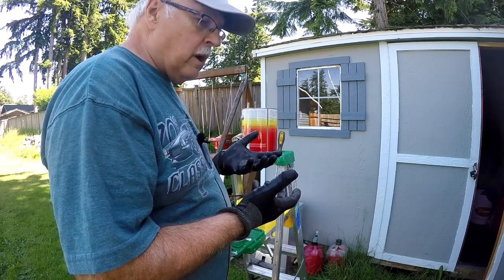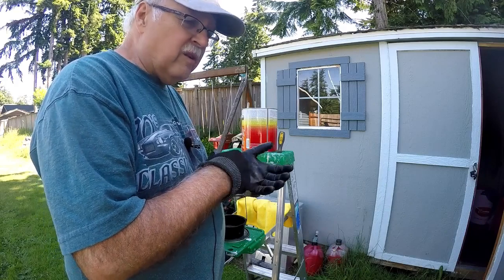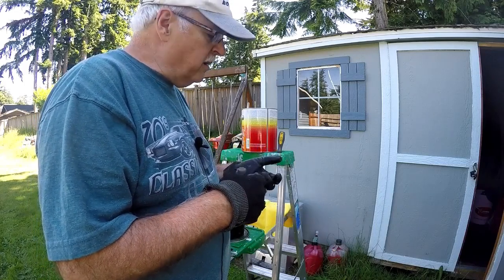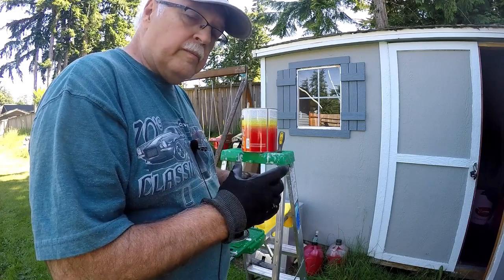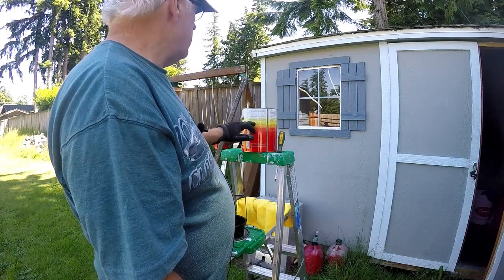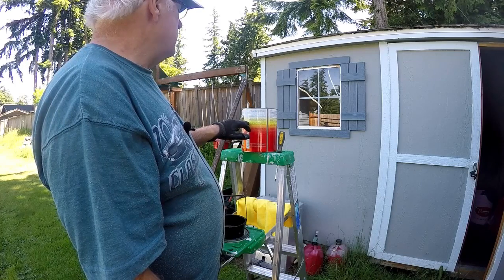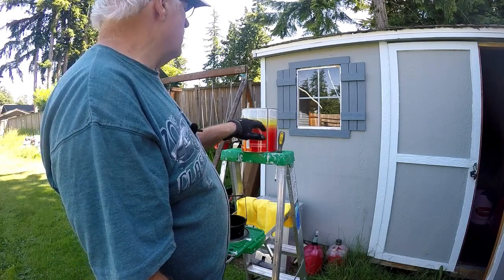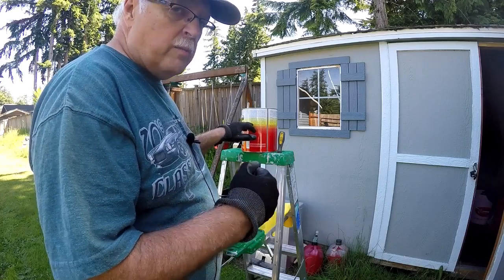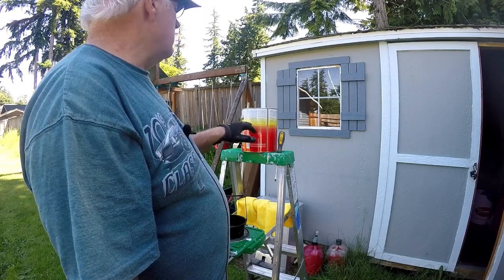So blow it dry, and then I use my carb cleaner to go over it and hit all the little holes right after I use this. You probably don't have to, but I do, because the nozzle on the carb cleaner aerosol can gets into all those little ports real good. It says for exceptional carbon or corroded parts, allow a longer soaking time, and some brushing may be necessary to scrub the parts. Rinse with water, and don't soak aluminum for over 4 hours.